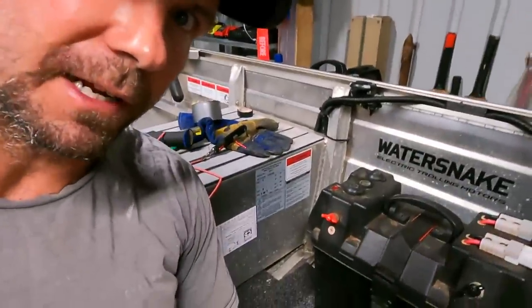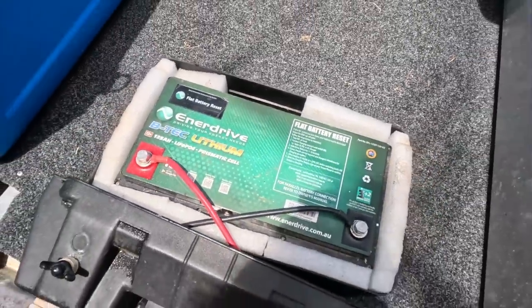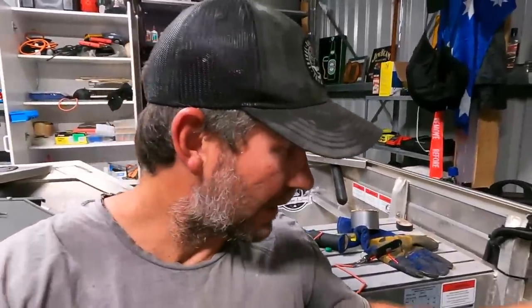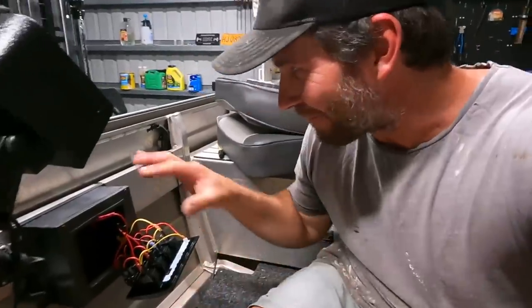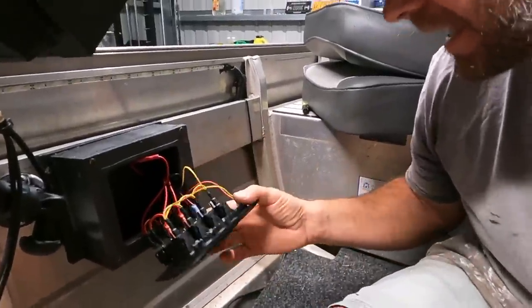It's time to show you how I'm going to power this thing up. I've had a battery over here for a while - inside that is an Enerdrive E-Lite 125 amp hour lithium battery. That goes in there in a little power pack. I've got power running this way - power off the front on an Anderson that goes up to the electric motor. I've run the power across down here, it's all fused properly. Drawing on my knowledge from back in the day as a motor mechanic. I've made this little fuse box here - this is where the switch panel is going to mount. It's a four-gang switch panel with rocker switches and a common earth.